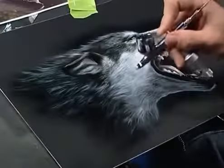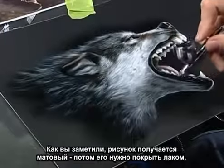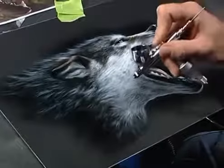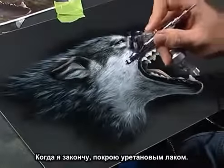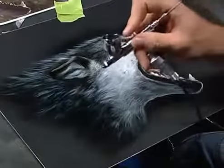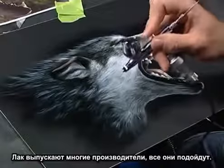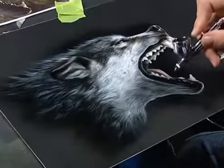As you can tell, we have a very matte finish on our background right now and over our surface. These panels and tanks are intended to be clear coated afterwards. So when we're done this project, we're going to put on a urethane solvent-based clear. Now you can use any manufacturer: Sikkens, RM, House of Color, Ditzler, Herbert Standox. It doesn't matter. The urethanes are pretty much all compatible.